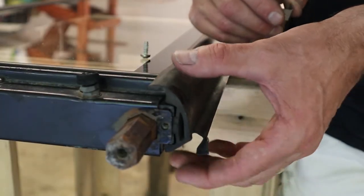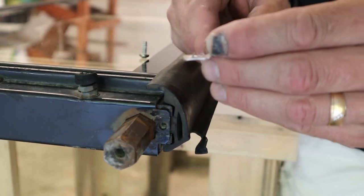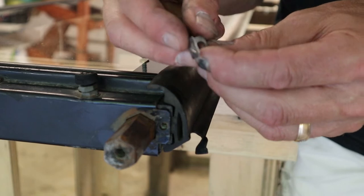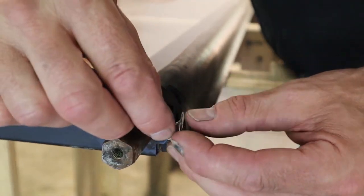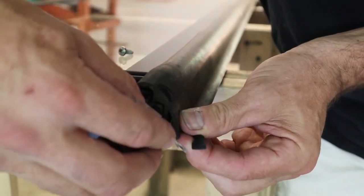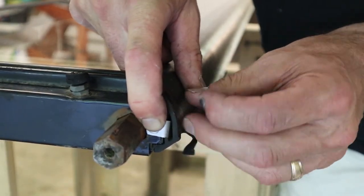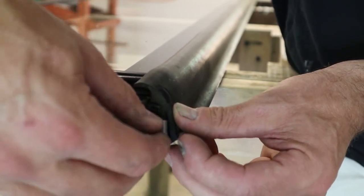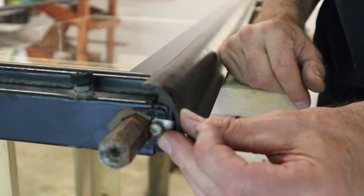In order to prevent these seals from sliding down the door, they have clips on them. These clips have a little edge to them, and that little piece is designed to go in that hole — it's a friction fit, and it friction fits against the rubber. When you push it all the way in, the rubber can't slide down because it's caught on that piece. Then you have a square drive screw bolt that goes in this hole and gets tightened down — one here, one on the opposite side, and two on the bottom.